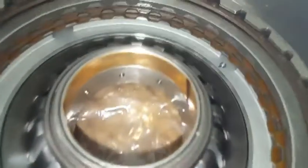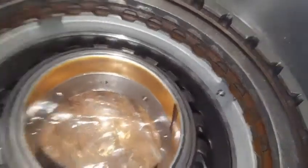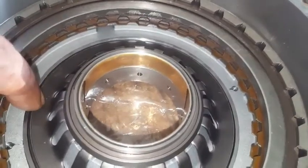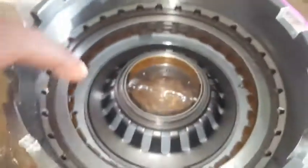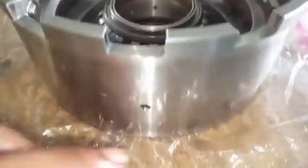You're going to notice in those two corners right here there are two ball valves. When the piston is moved back or down by this spring, the oil from that chamber will purge out of those ball valves. You're going to see there is a small hole, placing the transmission fluid in the area where the clutch is, dispensing itself from these holes on the outside.